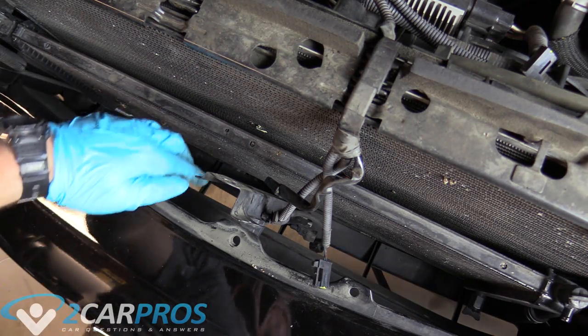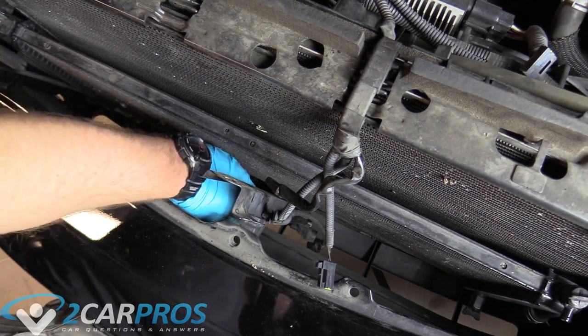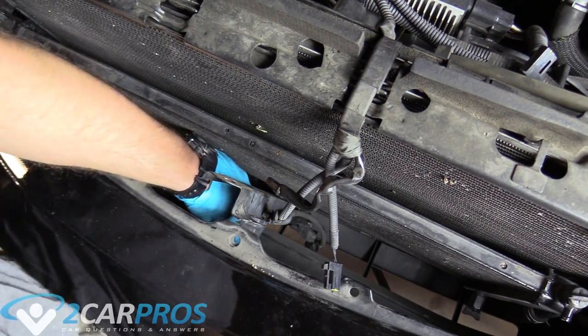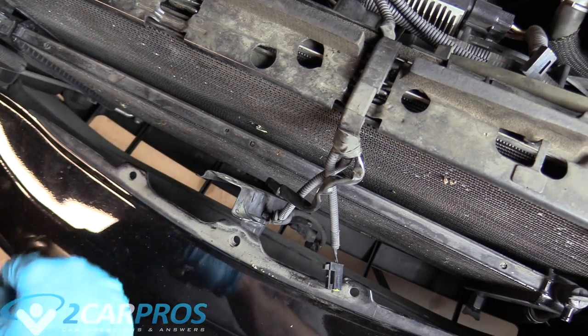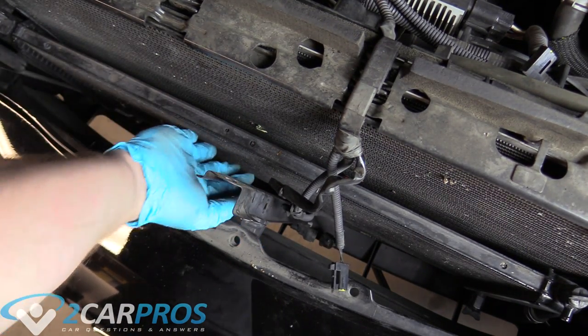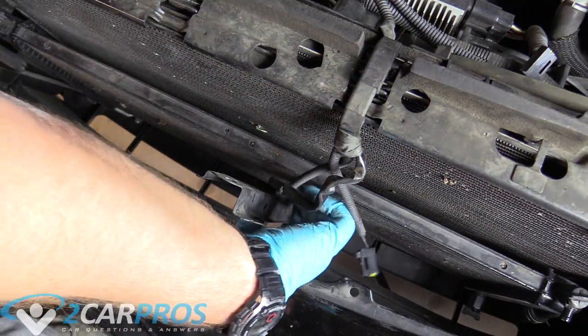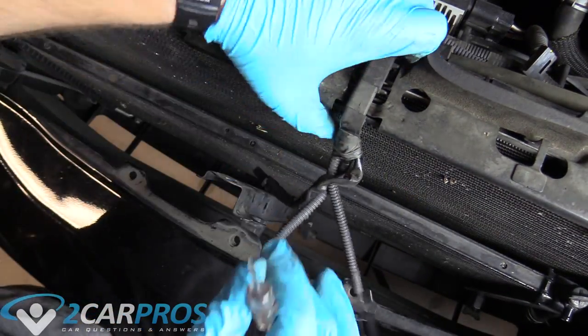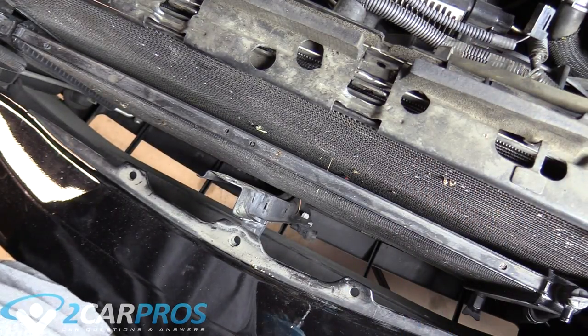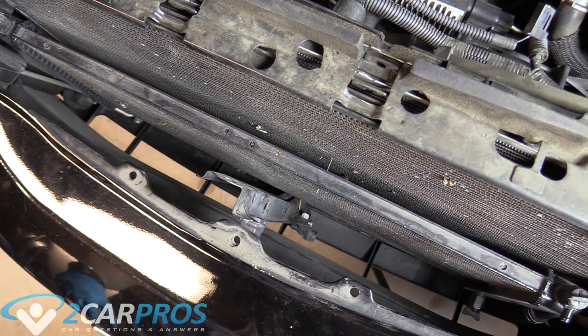Now we need to unmount it from the side — there's a little anchor on this side. You kind of force it through by pinching from both sides and massaging it out. There's another one deep down here as well. These plastic anchors kind of look like fish hooks — it works best if you can pinch them from behind, but there's not always room, so just do your best. Now we can remove this from the top of the radiator — another victory and we're one step closer.